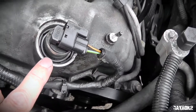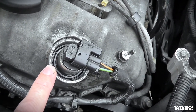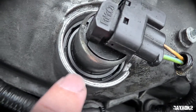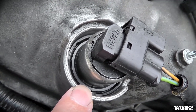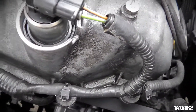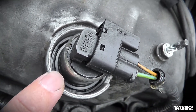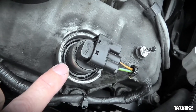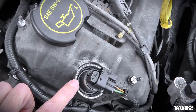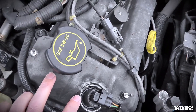These are your oil control valves, one on each bank, also possibly called VVT actuators — the service manual refers to them as oil control valves. There's a seal set down inside the valve cover and these seals are known to crack, rot, and leak. This one was cracked in half and leaking pretty badly. Believe it or not, Mazda does not sell these seals separately — they only sell the entire valve cover, and each one is about $150 to $160.